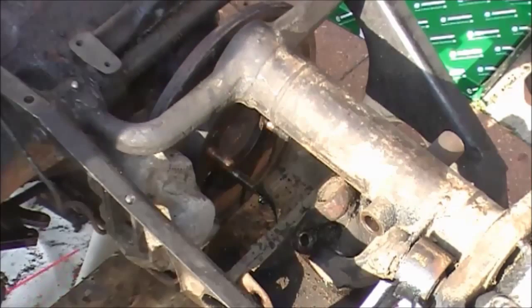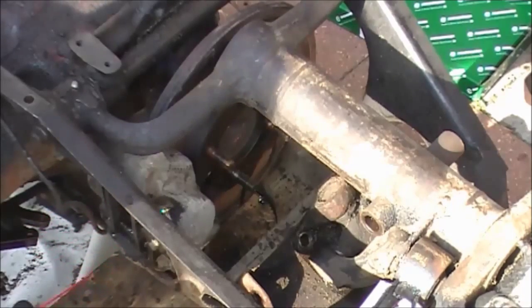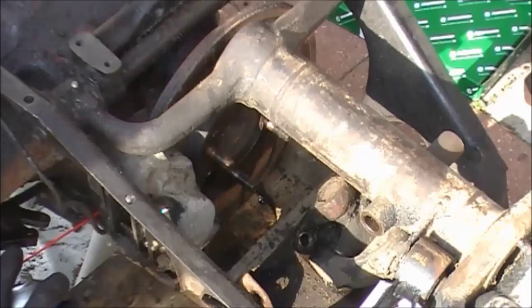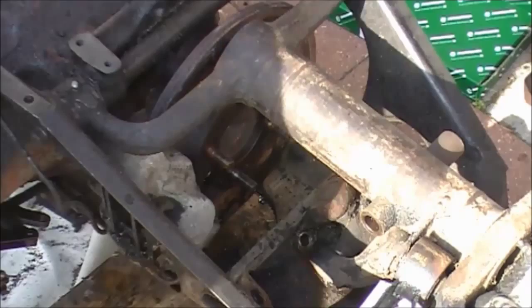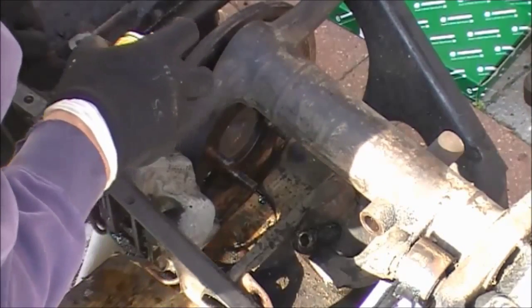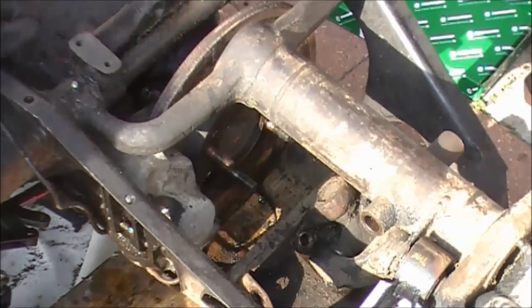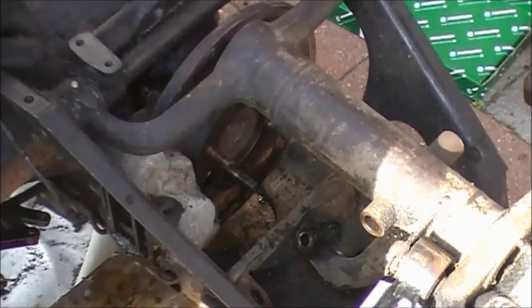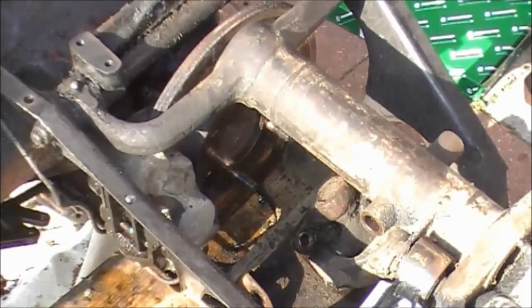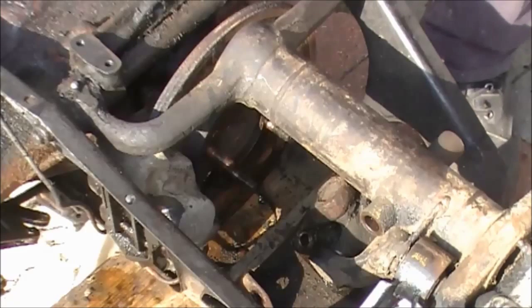In this case, I'm not sure that this rear suspension has had much work done in the last 45 years, and it does make sense to try and free things up as much as you can with large amounts of easing oil. So I do that as I go at every opportunity, and now I've got to turn the cage over so that I can get to the top and remove the handbrake mechanism.